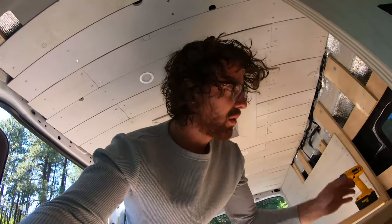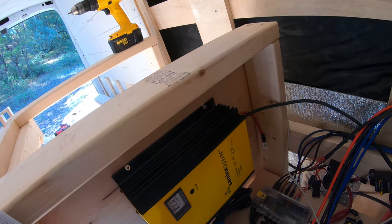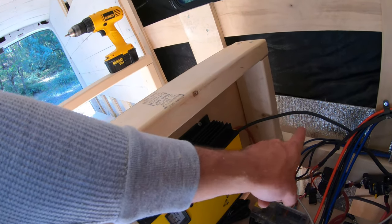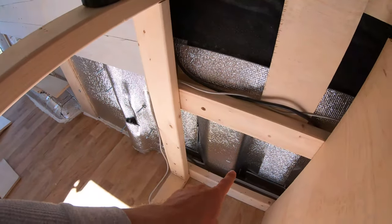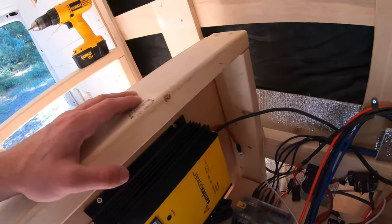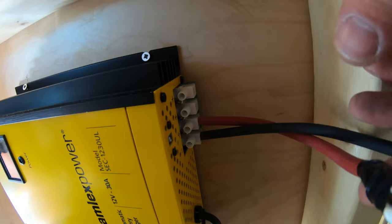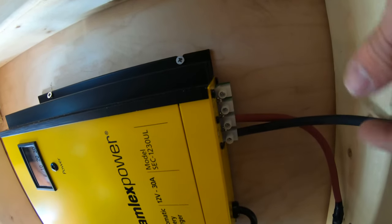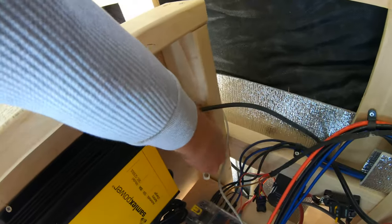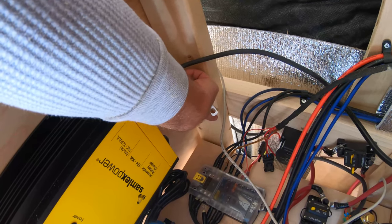We have our plywood mounted now to finish off the electrical box, and we also have our DC power box here mounted. It is mounted so that the wire going to be connected to the shore power will be able to run there — right behind here, and then probably right here is where I'll drill the hole out. The positive wire right here is fed into the positive and negative spouts here. You don't crimp these — you just cut the wire open, unscrew these little screws right here, stick the bare copper wire in, and screw it down so that it tightens onto the wire. So we have our positive wire right here.